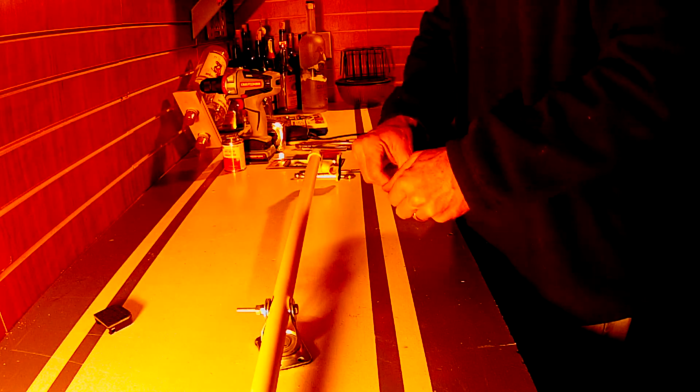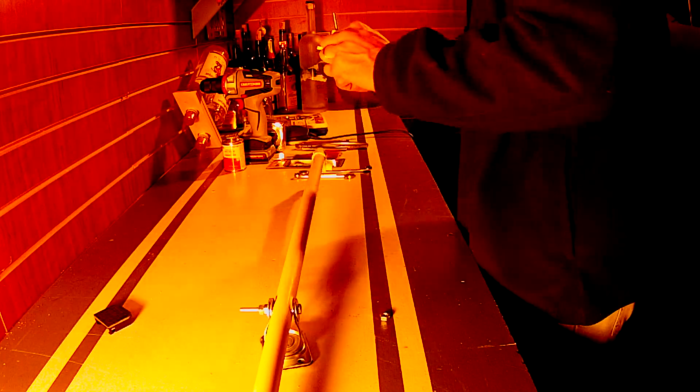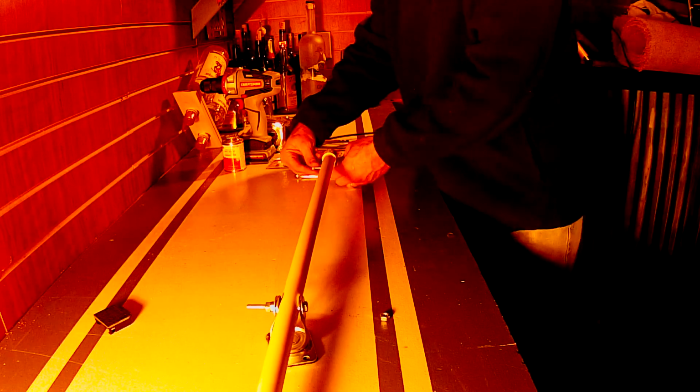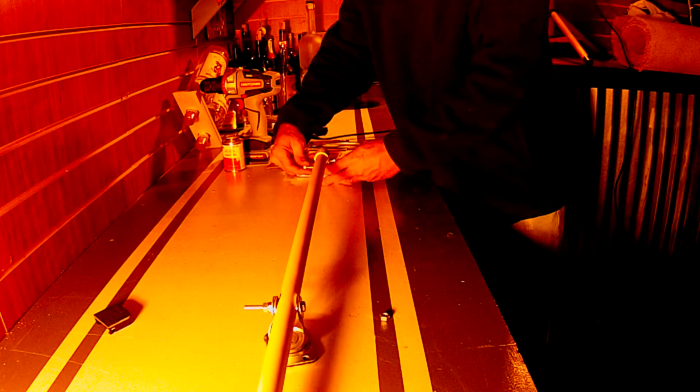And we have our 3½ inch bolt. When I drilled this out, I drilled a hole for this bolt. I took the Dremel and had to kind of wallow that out a little bit so the head of the bolt would countersink in there so it didn't interfere with the mounting bracket. And then I drilled a hole in this 90. Goes together like that. Doing here, get my arm out of the way.